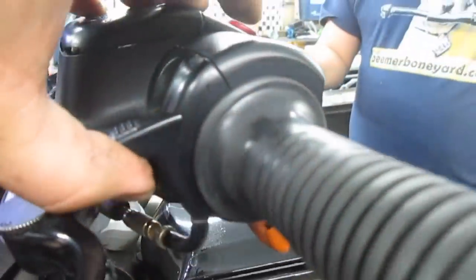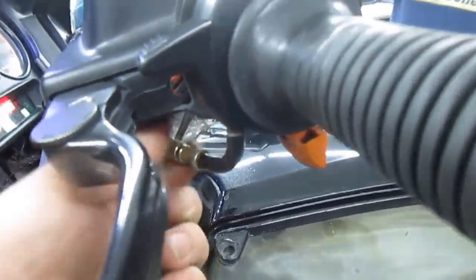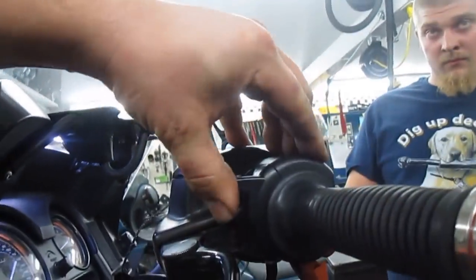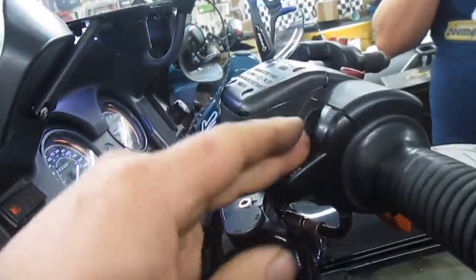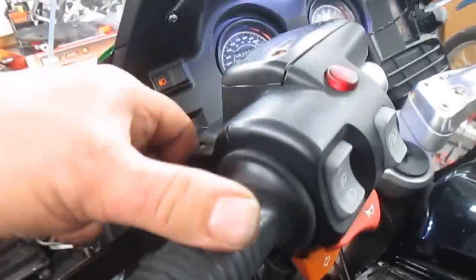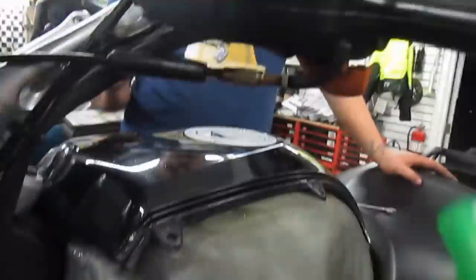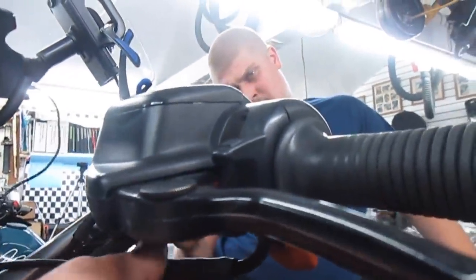Cable adjusted, you can see an increase in RPM with this on. It needs to be more than that. You see, this is all rusty. So this has probably been ineffective its full life. That's better. It's probably still got issues inside the junction box, but at least this works for a cold start. So now we add some alcohol to this. Slide that over to there, and that's all set.